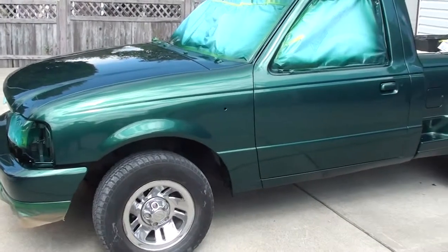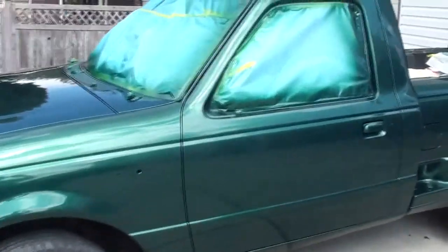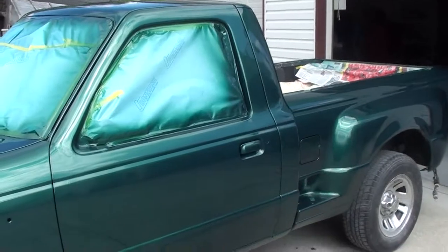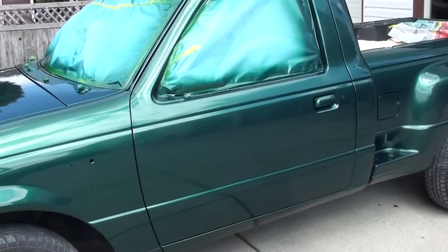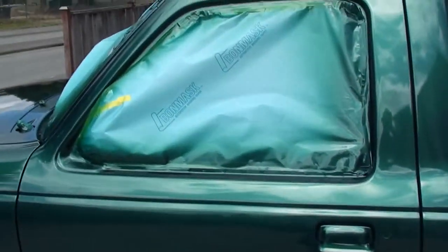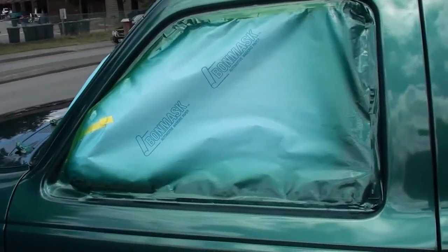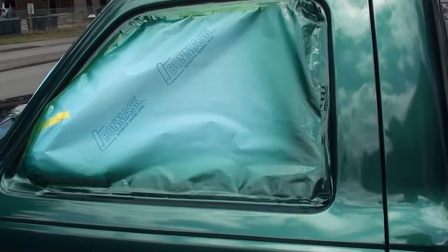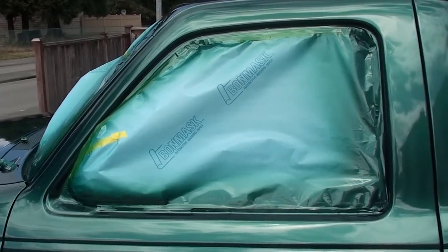Just to give you an idea why it costs so much to paint things these days compared to 20 or 30 years ago — this two-stage paint, which is a base coat and then clear coat over top, is often very expensive. But the most expensive thing is the labor to prepare it, because all the trim has to come off. In the old days you just masked off the chrome, the windows, the rubbers, but you can't do that anymore — you can't have an edge exposed to the weather because it'll peel. The adhesion properties of the clear coat are very poor.